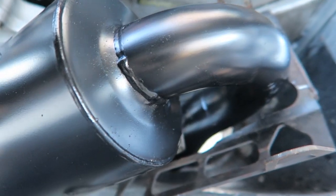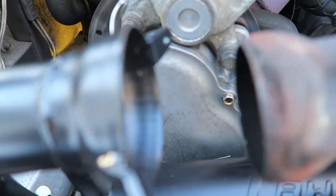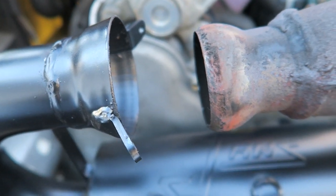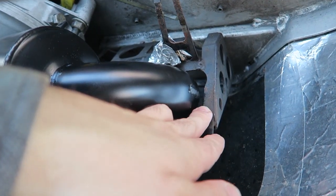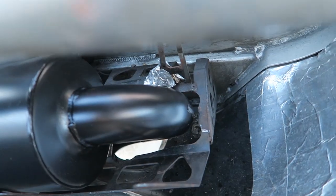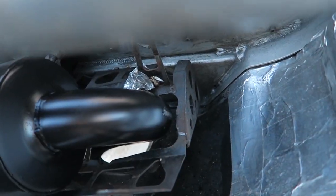I mean, down there you can see that it's just not going to match up with the hole either unless it comes that way, about another 1.5, 2 inches. Right now on the bottom it's off about 2 inches, and up here it's off about 2 inches as well. Maybe closer to 2.5 up here. So the only way you're going to make up that 2 inches is with the removal of this, and that's going to free up about all the play we need by far. We'll have to definitely put some heat tape lower on this though.